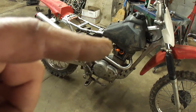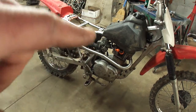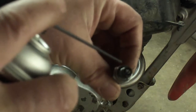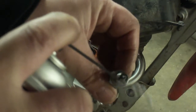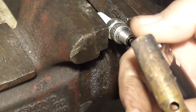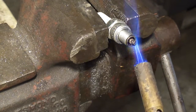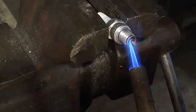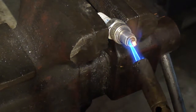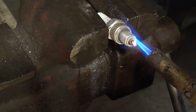It tried to make a couple little pops and bangs. So the next step is to pull that spark plug back out and clean it up real good, because just because it's sparking outside of the cylinder doesn't mean it's sparking inside with all that compression. I'm going to spray it out with some brake cleaner. The quick and easy method of cleaning the spark plug is to get your propane torch out and just heat this sucker up real good — this will burn off any impurities that could cause it to be fouled out.